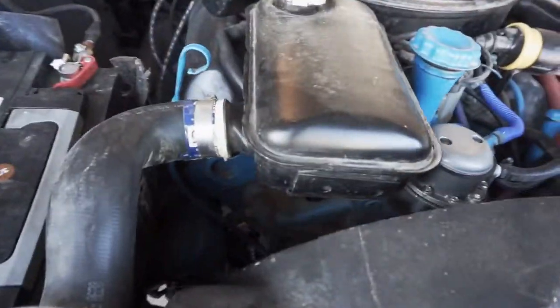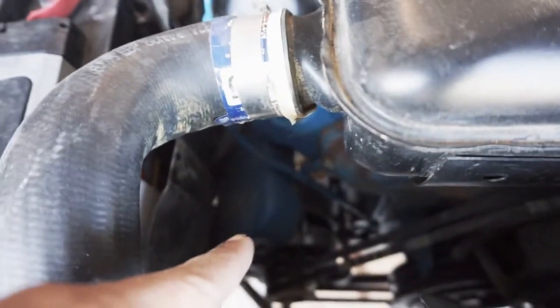The second thing I did was replace the alternator. That was also an easy job. But the alternator right out of the box was bad. I was going crazy trying to figure out why my battery wasn't charging. I changed the voltage regulator twice and still it was not charging — the alternator light was on on the dash. Finally I took it back to AutoZone, got a new one, and everything was fixed. Bad right out of the box.